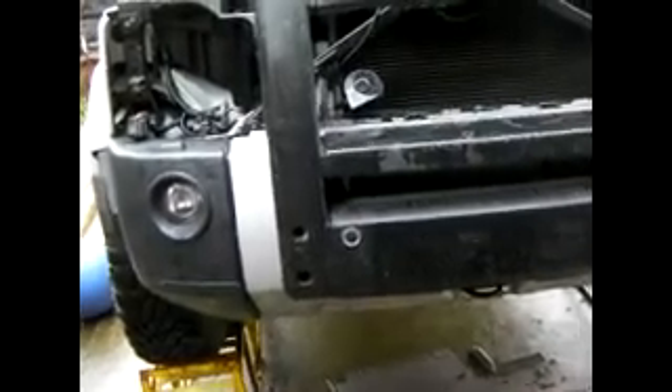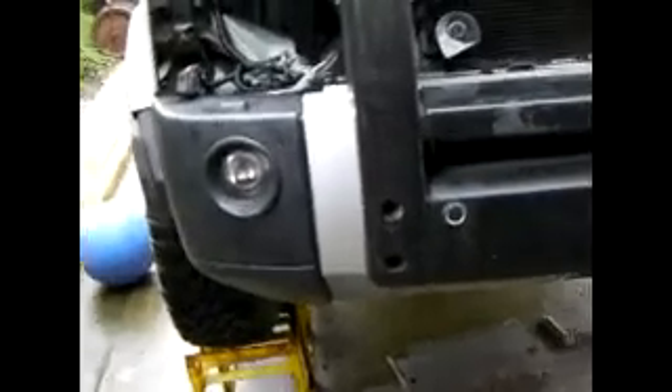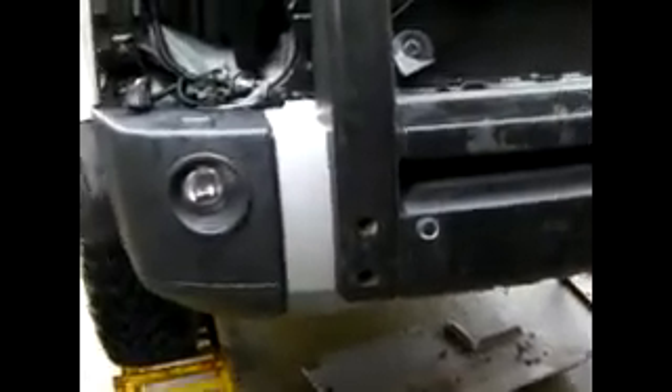I don't particularly want a huge 32mm hole in my bumper, so I'm going to drill a pilot hole of about 5 or 6mm, just barely breaking through the bumper. Then I'll pop the bumper back off and see how close I am to the wires, and then use a bigger bit to drill it out to maybe 13 millimetres. You can get plugs to blank the hole afterwards, so if I ever take the A-bar off or sell the D3, I can plug it with a 13mm plug and promote it as A-bar prepared. I'm going to get my drill and I'll let you know how I got on.